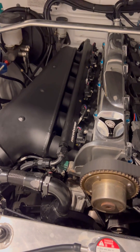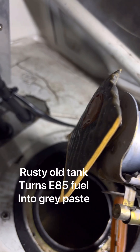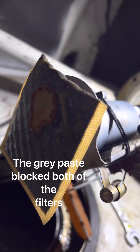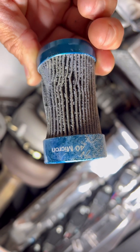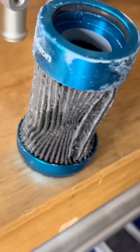We've had a problem with the fuel tank in the S13. The standard fuel tank had a bit of rust in it, and we're using E85 now, so the E85 will eat anything and turn it into a paste. What happened was the paste ended up blocking up the filters.